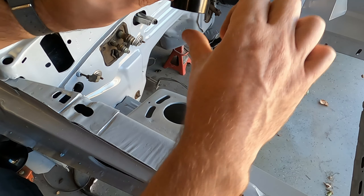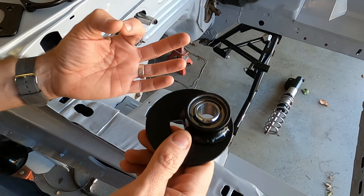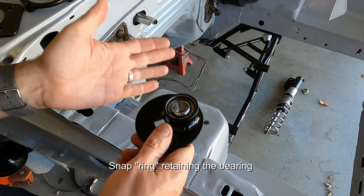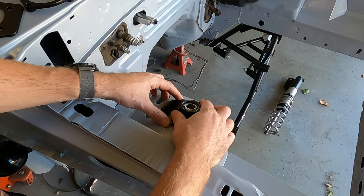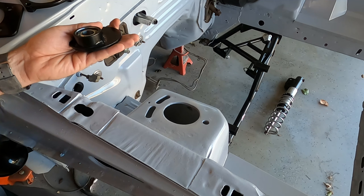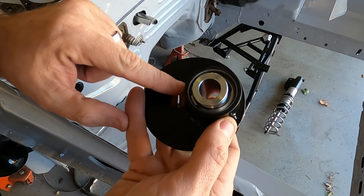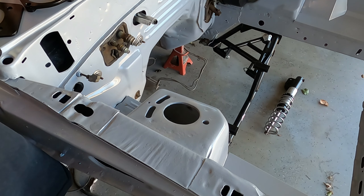Note that the bearing itself points down the car because you've got a snap ring bearing. If you read reviews, some people don't like this design — I almost guarantee they're installing it wrong. They've mentioned the snap bearing has broken, but the snap bearing really can't break if you install these correctly. People are probably putting these up top like a traditional Caster Camber plate design, which means the load is being pressed into the bearing and transferred to the snap ring. If that snap ring pops out you can ruin your bearing and have a lot of excessive play.